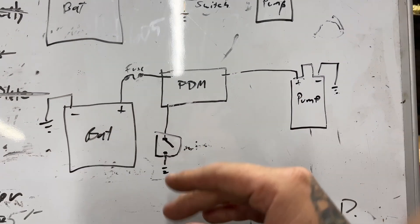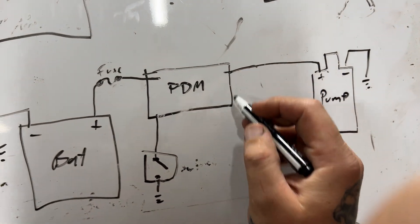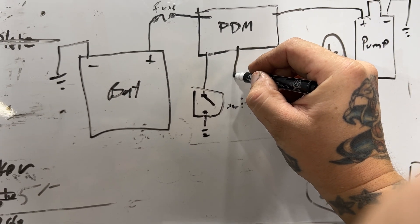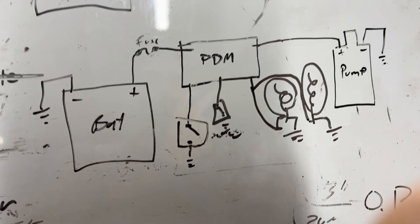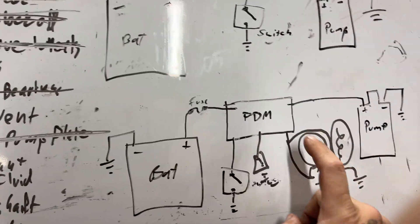You can also program this — like with parking lights, I want all the headlights on. It basically would do one switch for a bunch of outputs. You can program one switch to do multiple things if you wanted — so that's why it's far superior. We could do another example: a headlight bulb. You would have another switch or a program, and you'd have this split to each headlight. No fuses, no relays — they're all solid state built internal in this.